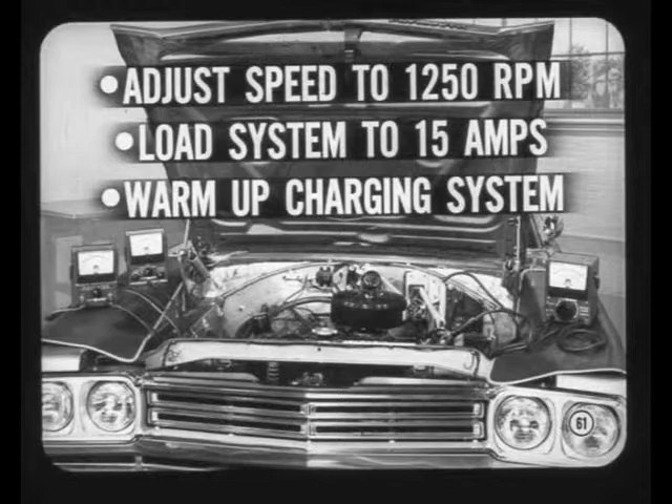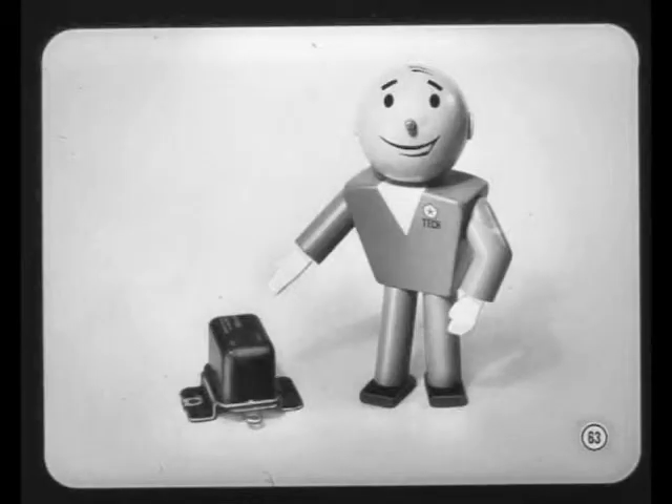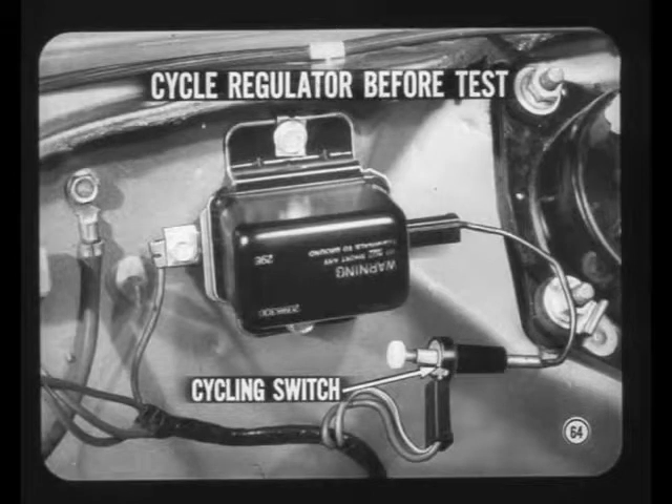Run the engine for 15 minutes as the manual specifies. The voltage regulator was out of the circuit during the other tests and is relatively cold. The regulator is temperature sensitive, so charging voltage varies during warm-up but stabilizes at normal operating temperature. In the specs, charging voltage depends on regulator temperature measured two inches from the regulator cover. Remember that the cover must be in place for all regulator tests, and be sure to cycle the regulator before taking each test reading.